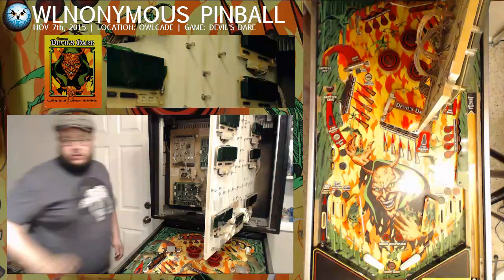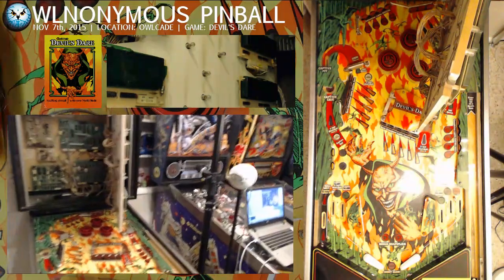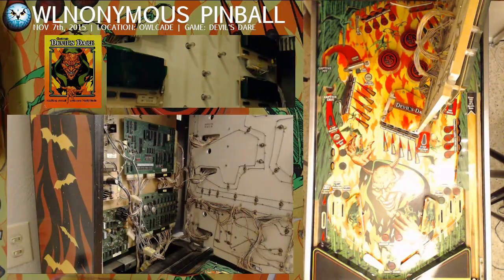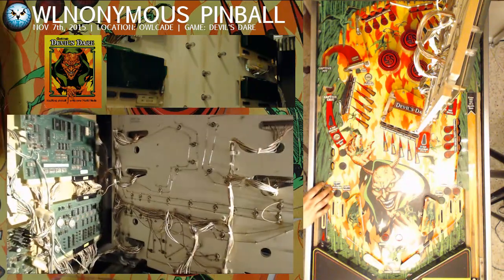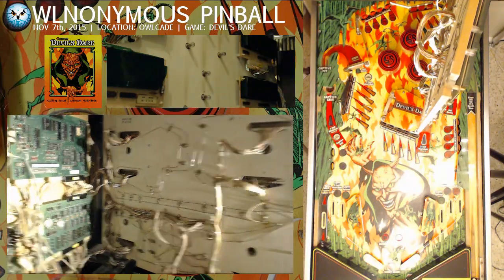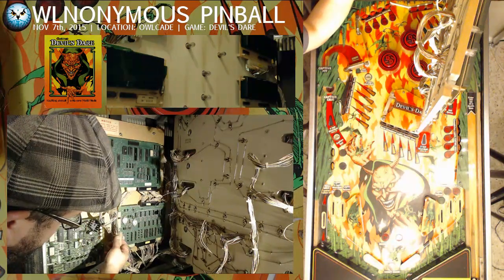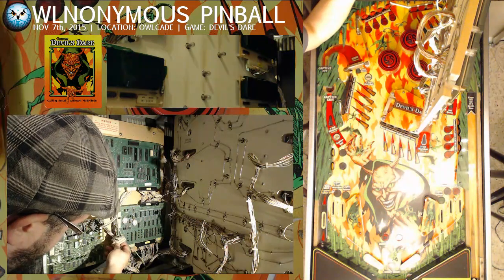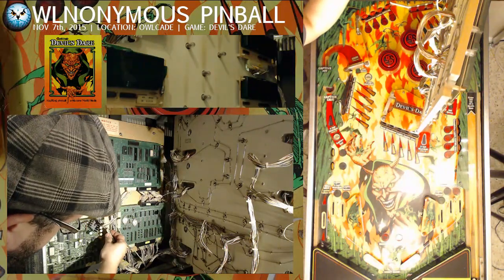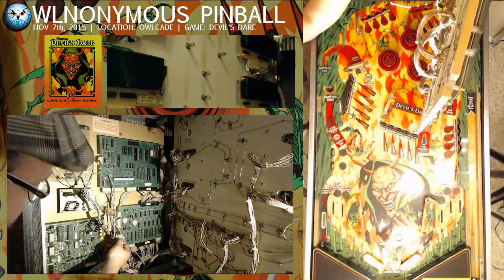Yeah, these you can't really show that well. But you can see a little bit of the bronzing and stuff on the connector. I'll try to show it. I can't really see the camera that well. But inside here, where are you? So inside here, this pin right here, oh yeah, you can see it right there easily. This pin's not connected all the way. And it's pushed back. This second pin right here is probably what's causing most of our issues with the sound.